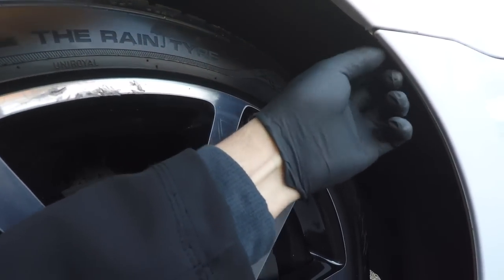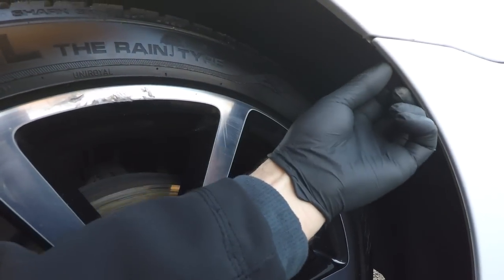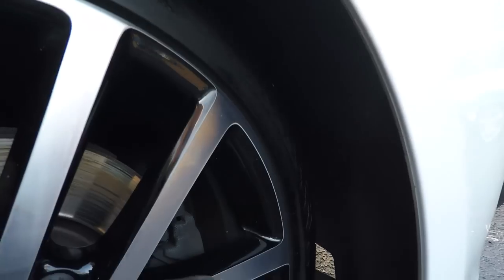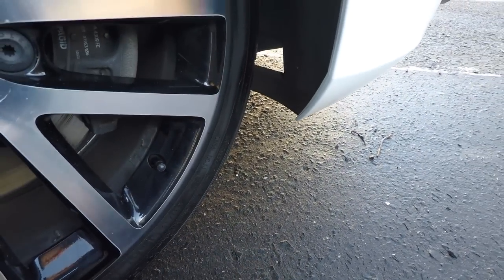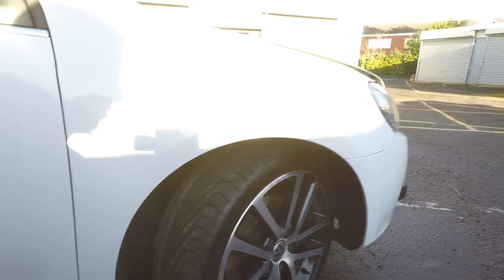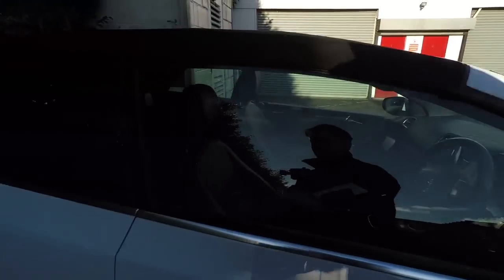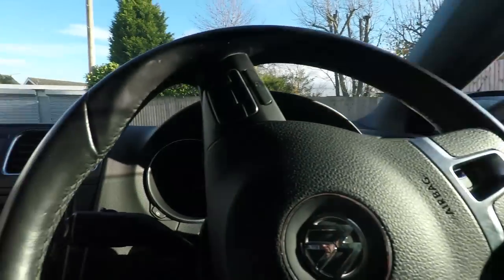And I think this one's a bit different to the others. Let's have a look. Yeah, it feels it is, because it's got a washer on it that keeps turning when I'm trying to unwind it. Let's see what we've got. Here we go. Yeah, slightly different, so it's got a loose washer on it. That one goes vertically upwards from the bumper into the wing. So 5 of those, 4 easy ones, 1 slightly harder. Put those on the table. That's that done. So now we're going to turn the steering the other way around and repeat on the other side.